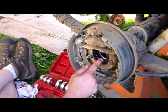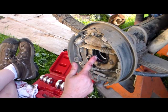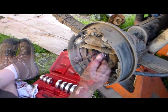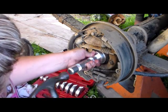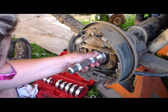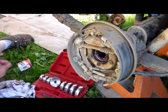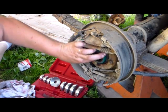What I've done is I've pulled out the old bearings and the old seals and cleaned out the inner tubes — I've sprayed some brake cleaner in there and dragged a rag through it. What I'm doing right now is I've added some grease to my new bearings and I'm ready to put them in. Now that the bearing is set in there, I'm going to put the seal in and pound it in there the same way.